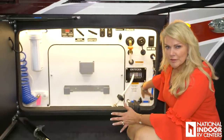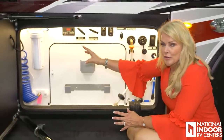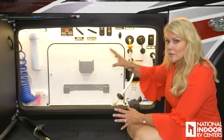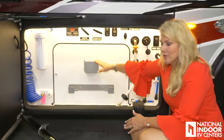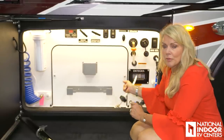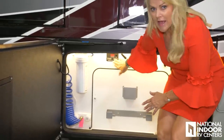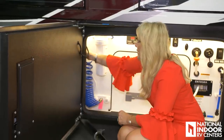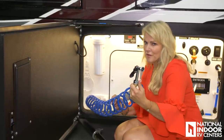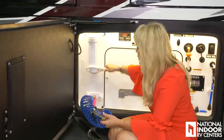At delivery, we'll install your water filter for all your drinking water and your refrigerator — it goes down to one micron. The filter for the rest of the coach goes down to five microns, so the drinking water is five times more filtered. We have a place for soap and paper towels, and behind this panel we have our Thetford SaniCon system and a manual where we can hook up and do a manual dump. We have our Sea Level 2 monitor system outside and inside the coach, and a hose for washing off feet, pets, or kids before going in.